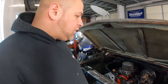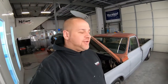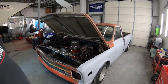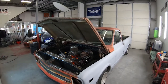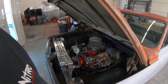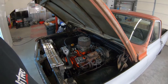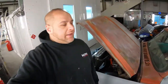We haven't gone for a maiden voyage down the freeway or anything, but we have taken it down to the gas station to fuel up and it seems to be operating just fine. It's been pretty reliable to start up every time. I would like to fix the power steering pump — I believe it is leaking and it's squealing a little bit. Once it loses its fluid this thing's really hard to turn. It does appear to be the pump, so we'll probably put a new pump in and go from there.